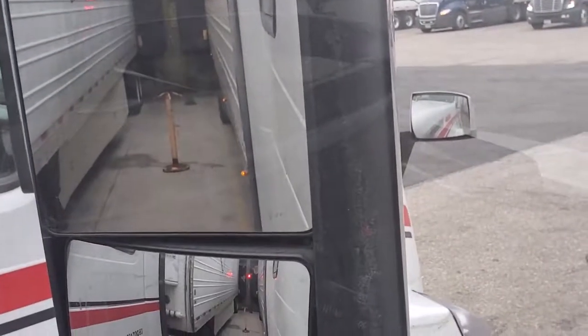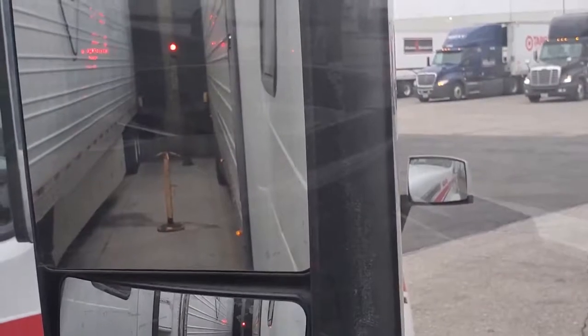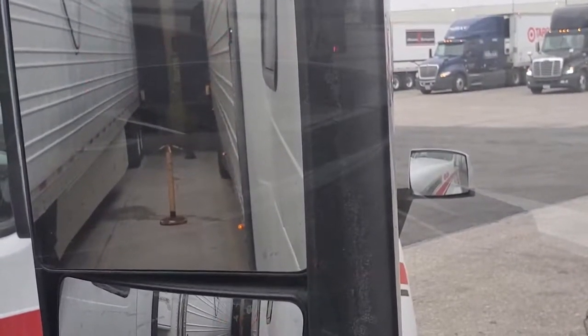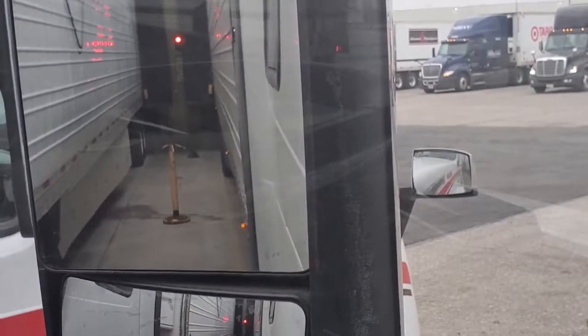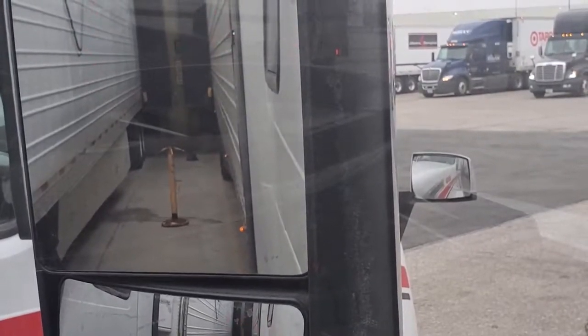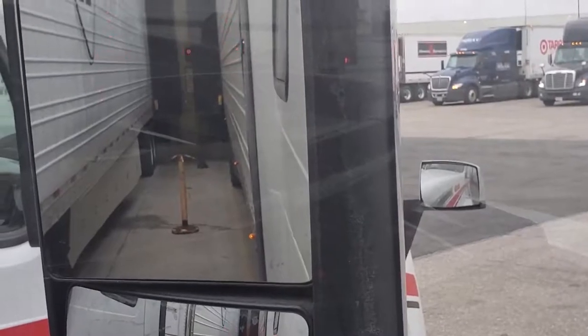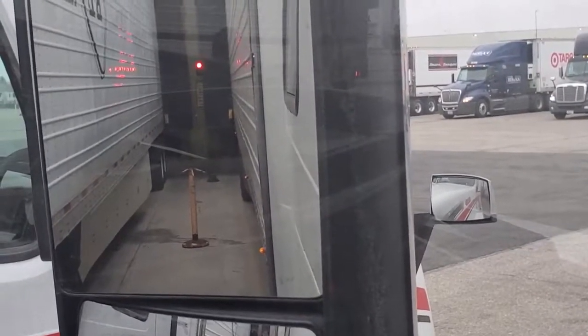As you're backing, you need to lean up and lean back until you actually get that nice straight line. The reason for that is because the people on the forklifts, when they're driving into the back of the trailer to load and unload it, they don't want to hit a big bump from the gap because that injures their back. So if you're going to be a nice driver, you always want to take care of that for your loaders. Otherwise they might miss some stuff and you've got a bad load on the opposite end. So just be aware — be courteous to your lumpers and your forklift drivers who are doing the work to get you loaded so that you can get to your next destination both safe and accurate.